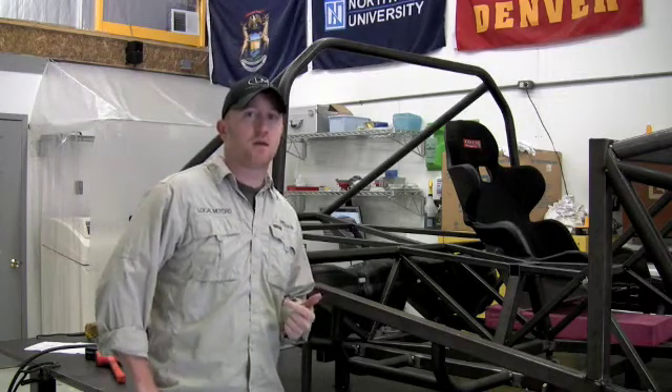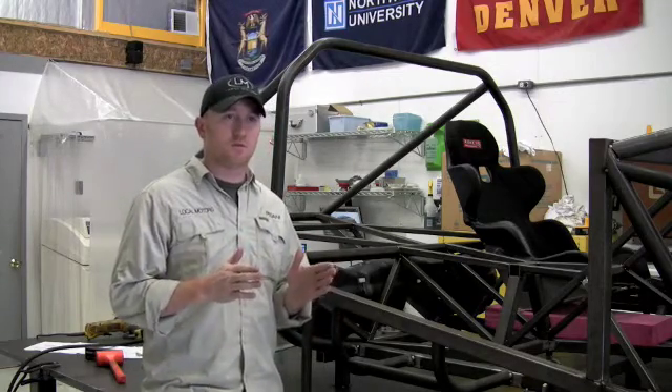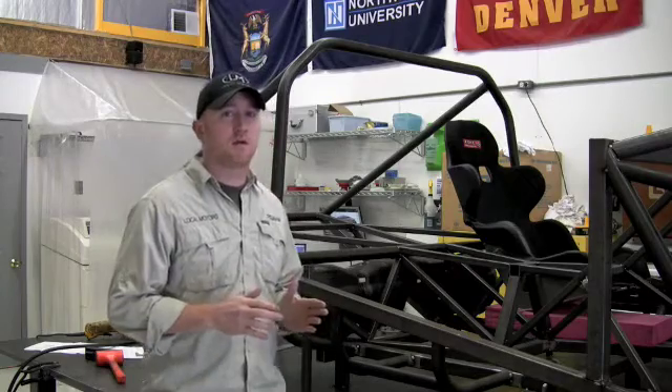The three most typical types of chassis you'll see are the ladder frame, the space frame, and a monocoque chassis — where the ladder frame is the simplest. It's pretty much a 2D structure, just like a ladder: it has two longitudinal tubes running up and down the vehicle with tubes in between to support them laterally. It doesn't offer a lot of rigidity — very simple design. Things like trucks and SUVs still use it, but it doesn't offer a lot of rigidity or crash protection.